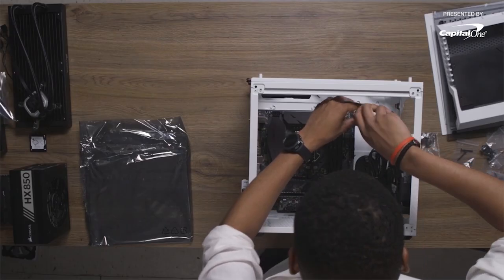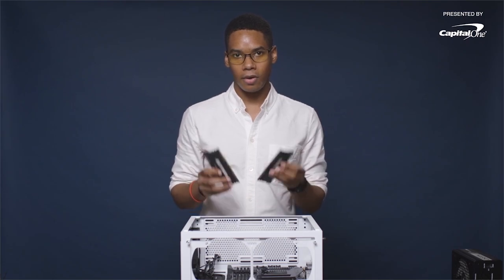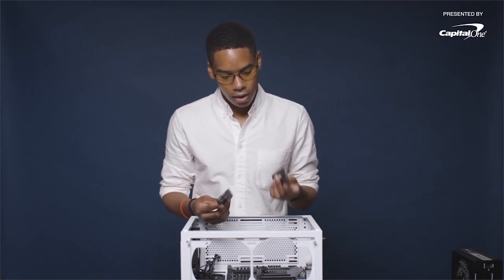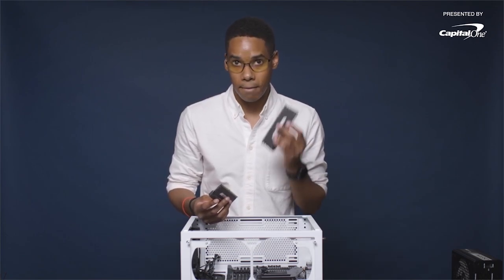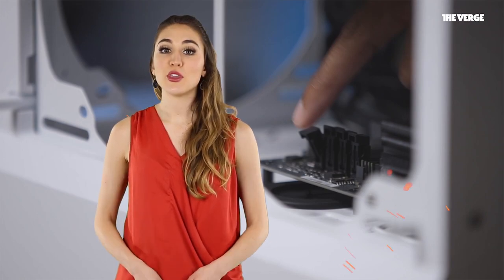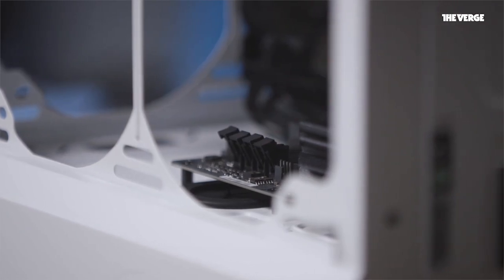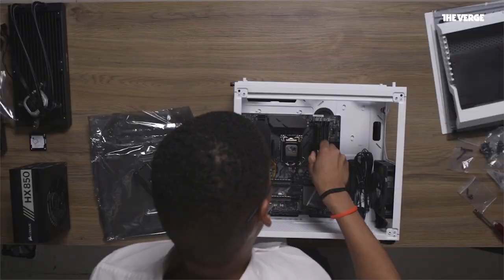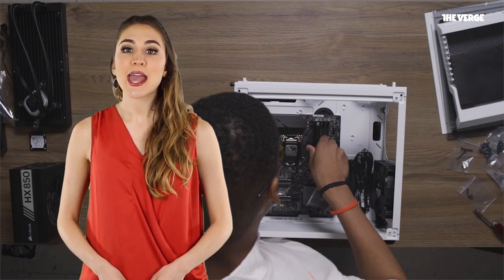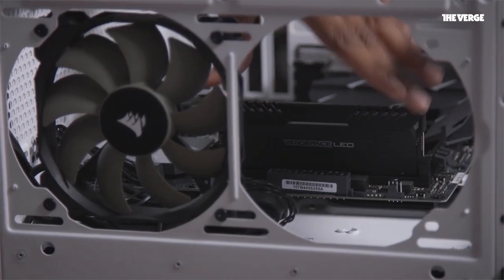We're just going to start installing all eight screws. Next we're going to install the RAM on the motherboard. I chose Corsair's 16GB Vengeance LED RAM — it has LEDs, and it's pretty fast at 2,666 MHz, which this motherboard supports. 2,666 MHz RAM is actually on the low end; you can get into the 4,000 MHz range, and anything around 3,200 MHz will be good. Open the slots first, aligning the stick with the middle of the strip, and lining that up with the logo. Check your motherboard manual to see what RAM slots are for what channel — installing RAM in the wrong slots can prevent your system from booting or result in slower performance. Once you hear that solid clasp and you don't see the gold connectors on the side anymore, that's when you know the RAM is in.